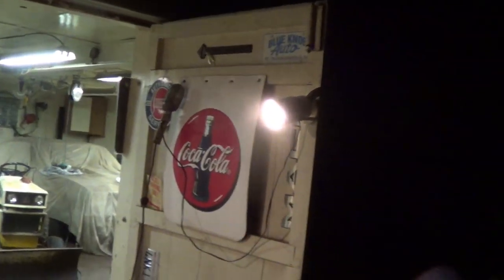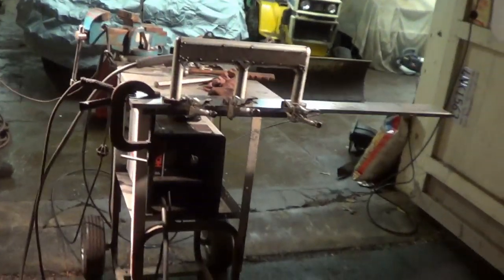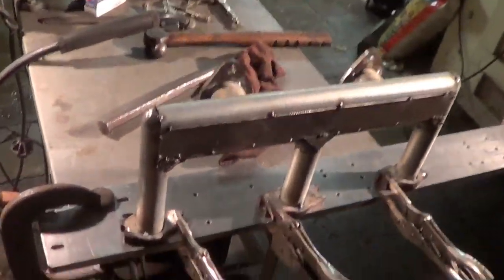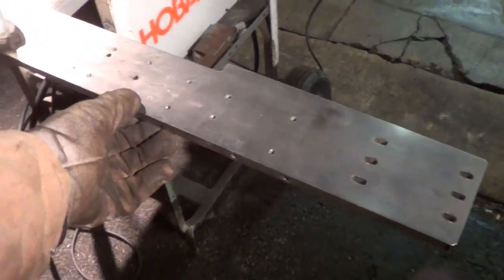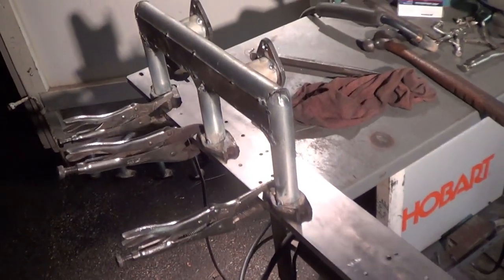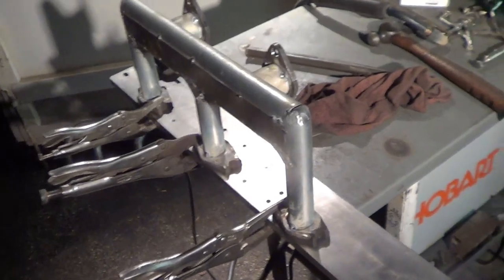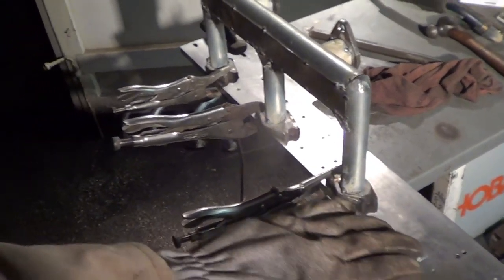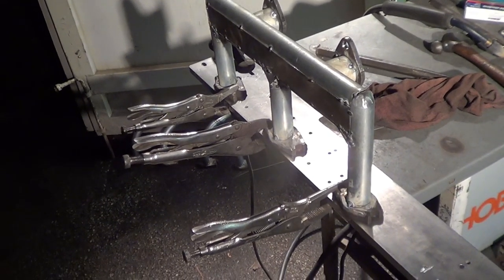It's time to burn some metal. I got the spotlight up and I stole one of mom's lamps from inside the house - she will be pissed. I'm going to weld up the intake manifold tonight. Got it all clamped down nice and flat. I also have a nice piece of stainless steel from work, about a half inch thick and nice and long - this will help dissipate heat and also help keep the flanges nice and parallel. Let's get something done.